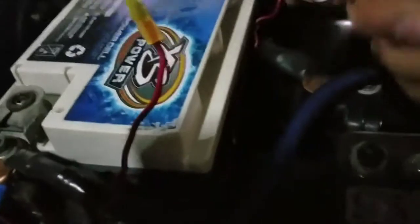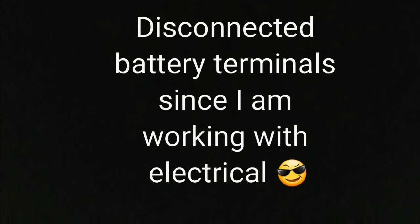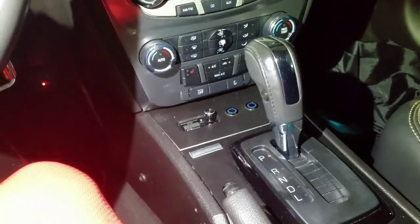Time to put a terminal on — I know it's not the right size for it, but oh well, screw it. That's done — let that cool down, do the same for the negative and we're done up here. We got the power wire through. Basically we're running it the same way where the RCAs are. It looks a bit messy — we're going in from the backside, so we'll pull all this out. Super dirty in there. Pull all this out and get to wiring the voltmeter. Everything's all wired up — let's go and test it out.